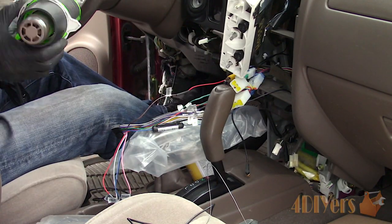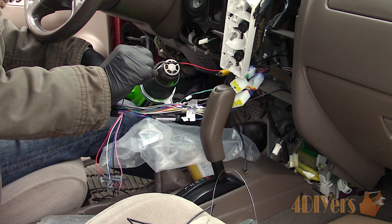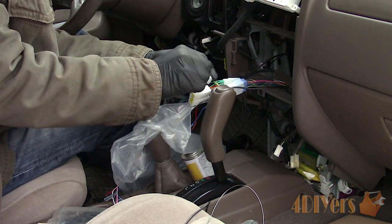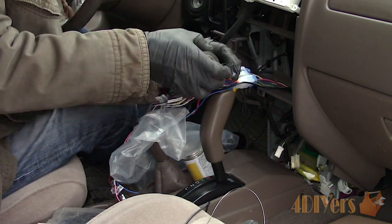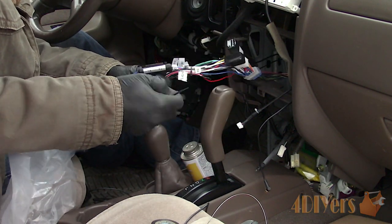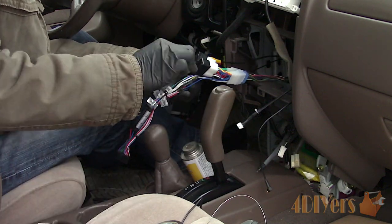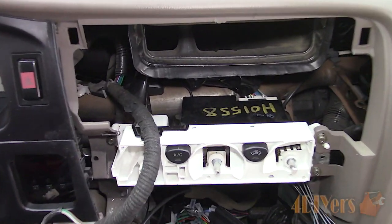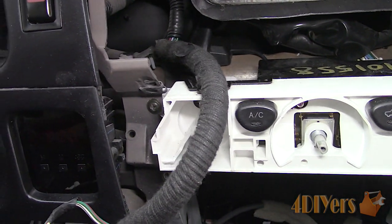In the truck, for the reverse camera, in order for the head unit to turn on the video mode for the backup camera, the labeled camera wire gets connected to the red wire on the video cable — this connection was soldered and had heat shrink applied. Those extra connections on the harness, while they do have caps, can still fall out, so I wrapped them up with electrical tape just to be safe. Next is organizing all the wiring using cable ties — this will keep everything clean, reduce the chance of the wires becoming damaged, and makes it easier to push everything back inside the dashboard. I have left the GPS and WiFi wires on their own just to reduce any chance of interference. The GPS antenna has a magnetic base — it should be attached to a metal base to amplify the signal. I stuck it on the metal tube brace inside the dashboard, then used a cable tie for a little extra security.